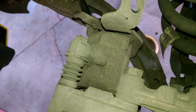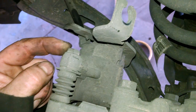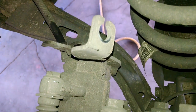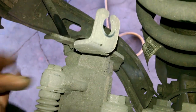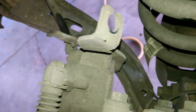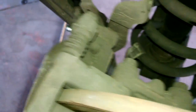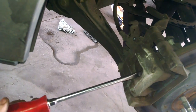You will find the bolts to be different sizes possibly — this is probably 13, but the new calipers are 15. Everything is left to loosen, right to tighten — of course you're looking from the other direction. Take those two caliper bolts off and then unscrew the caliper. That's really it — it'll be right off in your hands.